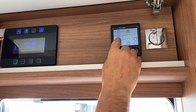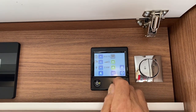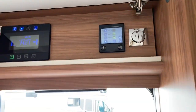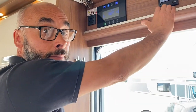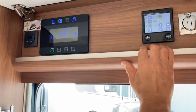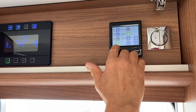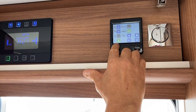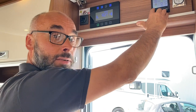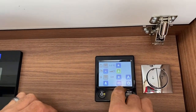The third line is for when you're on hook-up — you have three settings: one kilowatt, two kilowatts, or three kilowatts. If you're on a site with good power, have it on three — it'll do the same job, just quicker. If you're not on hook-up, switch to gas using the gas symbol. Just be aware that because it's such a good, big system, if you've got heating on with gas, it will use your gas quite quickly, so use electric wherever you can.